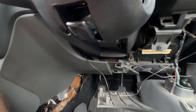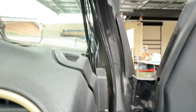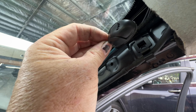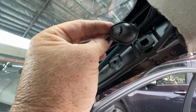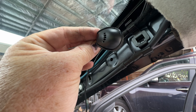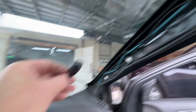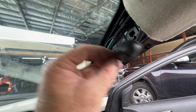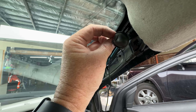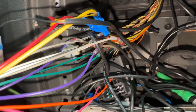From where the head unit is, I've run the microphone cable through here — it's going to come out and up behind all these trims, up this pillar trim. I'll mount it on the pillar trim up here because it is fairly directional, so it's best to be in the field of your mouth and voice. The top of the dash is a good spot but it looks terrible, so I always put it on the pillar trim. This one's got double-sided tape so I'll angle it accordingly.